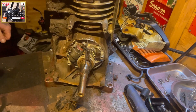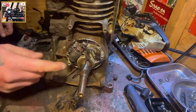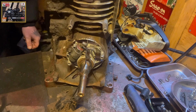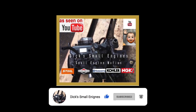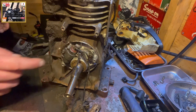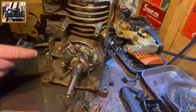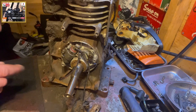This is Small Engines. In this little episode I'm going to show you how to set the gap on the points and condenser ignition system. Here's your condenser, here's your points — an older ignition system. In this case it's on the horizontal Briggs 3 horsepower.